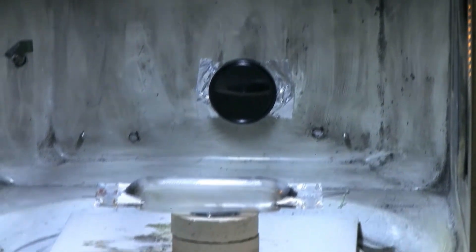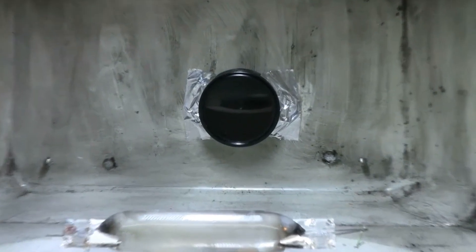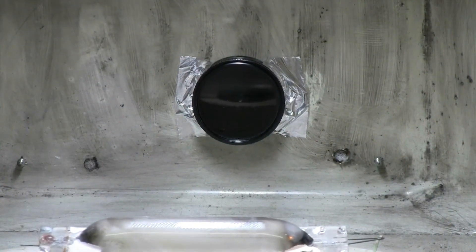The primary video port is cut in the back of the microwave. There's a filter on there that reduces the brightness so the camera isn't overloaded to just record a white image with no detail. The filter is two circular polarizers stacked one on top of the other. As you turn one, the cross polarizers will let either nearly all of the light through or nearly none of it, giving a variable brightness filter.